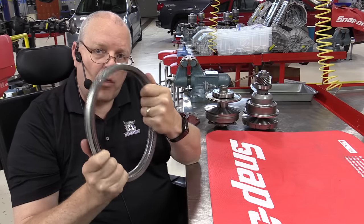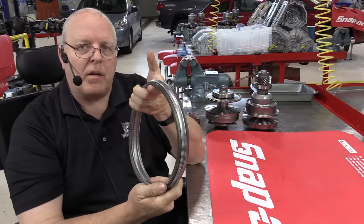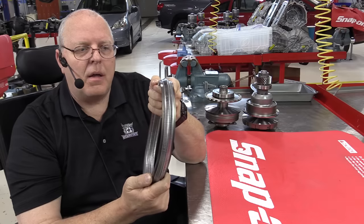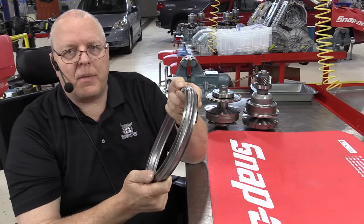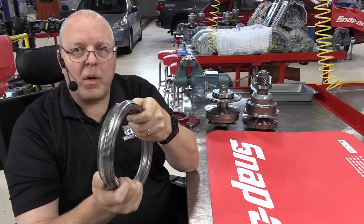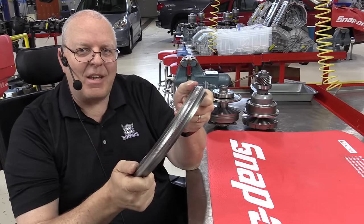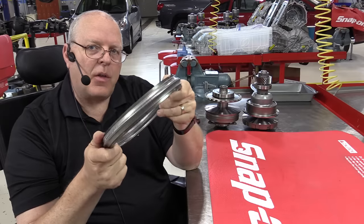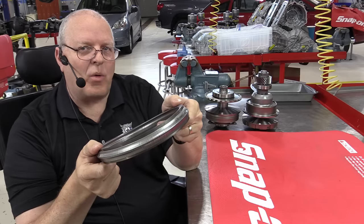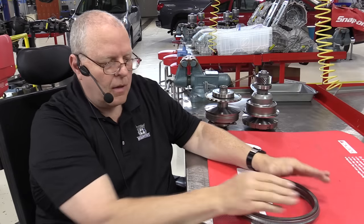We've now taken 399 elements, the arrow of directional rotation, and two ring packs of 12 rings each — each ring seven and a half thousandths of an inch thick, so 90 thousandths of an inch for all 12 together. That's 24 rings plus 399 elements — 423 pieces total just in this flexible CVT belt. That is the construction of a CVT belt. Put some zip ties around it as you're removing and reinstalling it in the transmission so it doesn't scatter and fall all over the place. Thank you for watching.